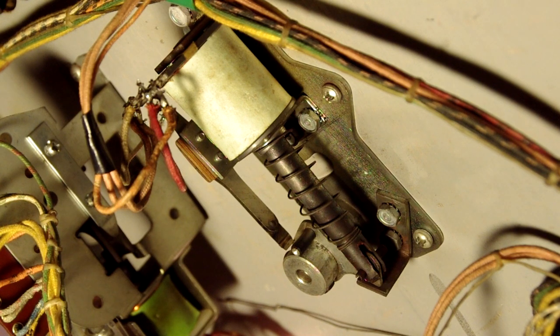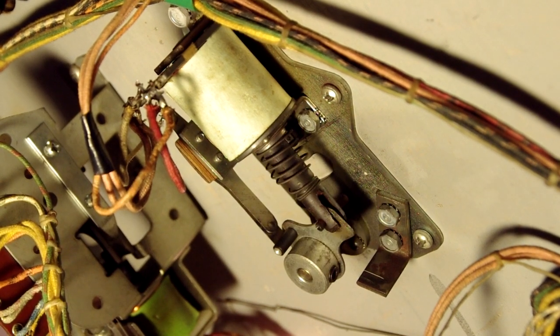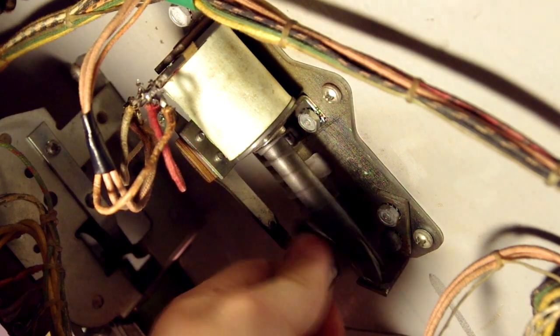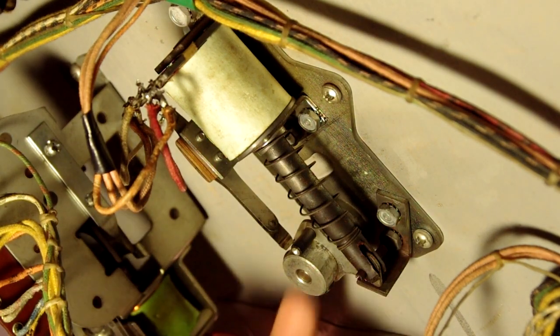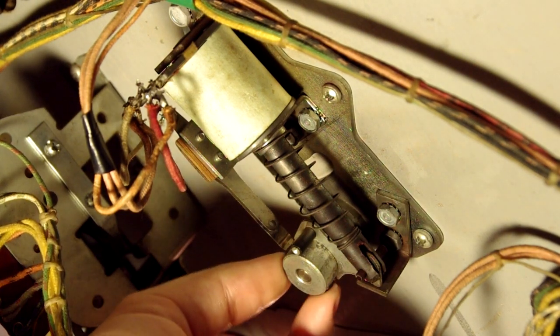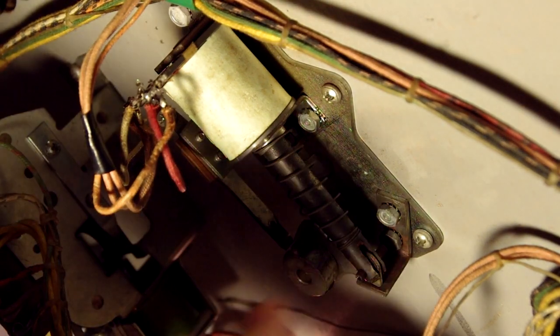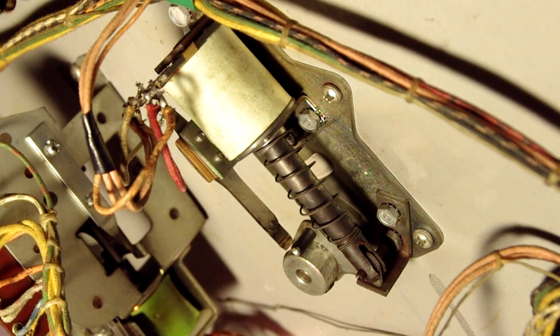You can tell there's a large difference between the low and high power coils by manually moving the flipper out of position while holding down the flipper button. You can hear a slight buzzing when I have the flipper button held down, but if I reach and move the flipper out of position the buzzing gets much louder. The lights on the machine are also dimming when I do that — it's using quite a lot of power. In terms of the actual linkages, the plunger is attached to a piece which rotates. The shaft of the flipper comes down through the playfield and is held by a couple of Allen screws. When the solenoid pulls back it causes the shaft to rotate, which moves the flipper up on the other side of the playfield.